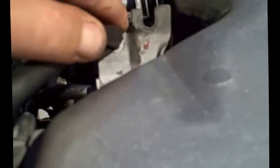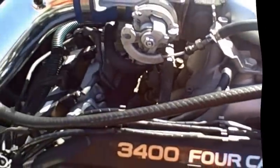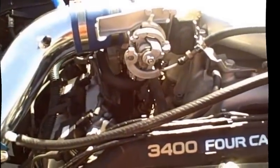The other option that other people have spoken about that's effective is to take a Dremel, cut it down that little line right there that you see, split it, and then bend just this portion right here. Either way, just know this is going to have to be adjusted. So let's go ahead and take apart the throttle body and I'll talk about how to clean it out properly. And maybe I'll talk about how to do some testing to make sure it works. So hang tight.